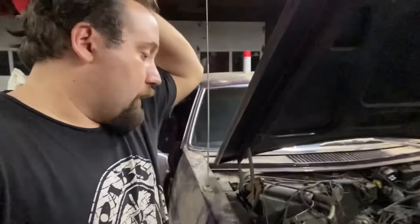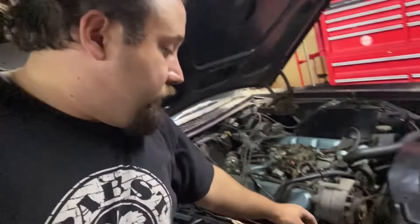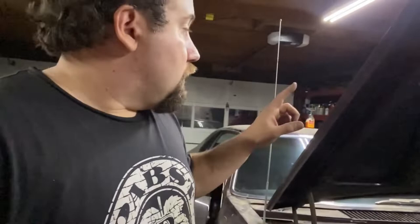So, I'm starting closest to the battery, and coincidentally, the closest thing to the battery is the horn relay. So unplug that, and when we run her right to power, the horn works. This relay might even work. We'll test that next. Means the controls on the steering wheel don't work. But we'll get to that when we get behind the dash. We're testing from the battery back.